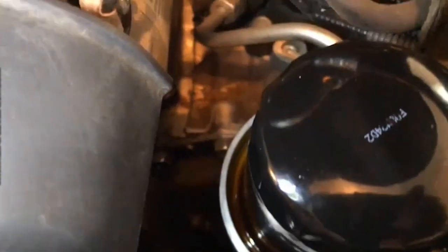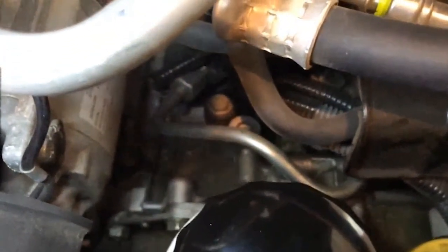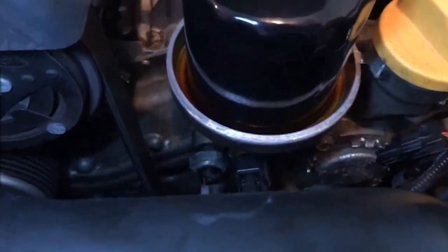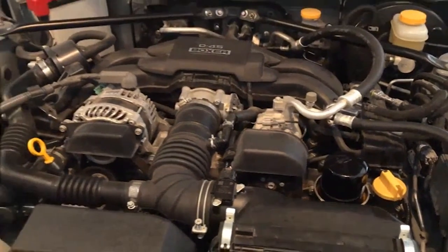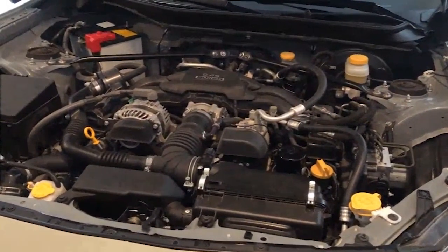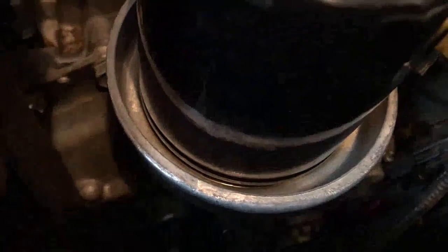The effect of replacing your old oil filter during the last oil change might have an impact if you happen to use that cheap or free one that comes with the oil change package at your local auto parts store. Big surprise — that kind of oil filter isn't made for this engine. Every engine is different, and especially the 86 platform car comes equipped with a flat-4 boxer engine that uses a specific size and type of oil filter that is mounted high above the engine. If you use the wrong type of oil filter simply because it came for free, you're going to have leaks, and those leaks, if you take a hard left or right turn, are going to spill onto the engine and cause white smoke to be spewed out of your car.